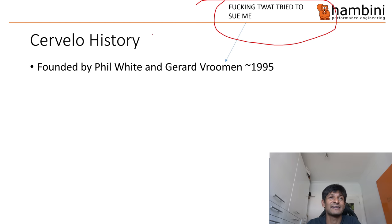This is an overview of BBright — normally 79 by 46, used by Cervelo. One thing to note is that if you've got a power meter or something that impinges outward, you don't get much clearance with BBright, and that's one of the drawbacks. This is a sectional drawing — general arrangement of BBright as is. That's a Hambini BBright 24mm, so it's a Shimano axle. And that is the same one for PF30. You can see the similarities when you zoom in — the outsides are like the same. The advantage with the BBright is that because this is all captive inside the frame, it tends to be a bit stiffer.